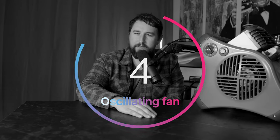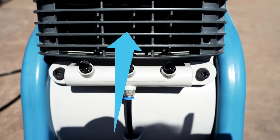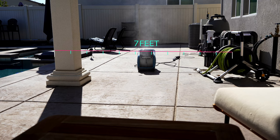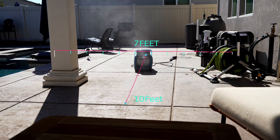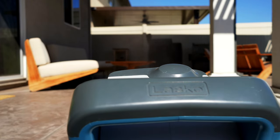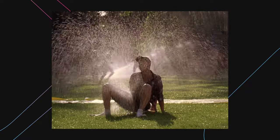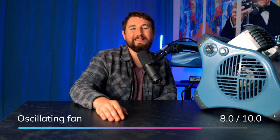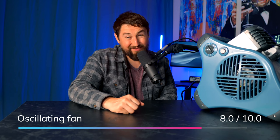Number four: oscillating fan score. It has propellers inside that direct the air left to right, so it's not going anywhere near as wide as a regular oscillating fan. Up close, you can't even feel that it's changing direction. However, those little propellers do a great job if you're about 10 feet back. I was getting an area of about seven feet wide of powerful mist at 10 feet back, and then it continued to spread out and dissipate up to 20 feet away. It feels great — cools you down, goes away — and in hot weather you're pretty much dry by the time it comes back. At 10 feet away, I give it an 8 out of 10 for oscillating. Up close, it's a zero out of 10.